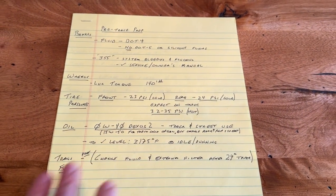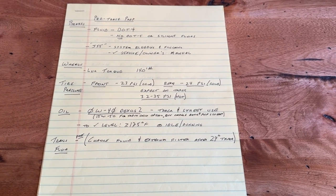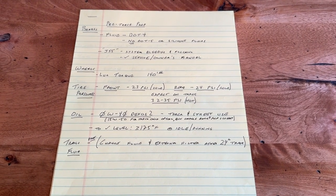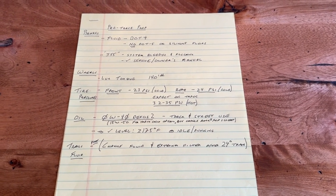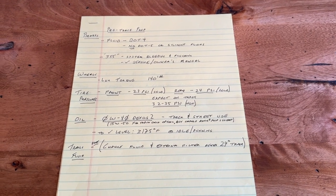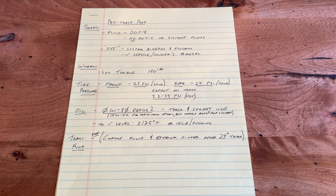We got the wheels torqued to 140 pounds each — that was pretty easy. These are what the front and rear tire pressures are supposed to be. When you go to track, you want to have the 0W40 Dexos 2, which is sometimes called the supercar oil. That's what they called it at Patriot Chevrolet before we did the oil and filter change. The car only had 1,300 miles on it, but I was still getting a notification that it needed an oil change — and that was based upon time. I received the car in November and got it used a few months prior.